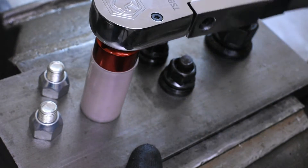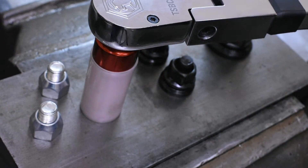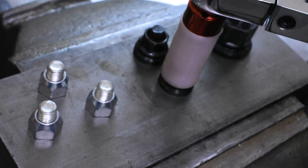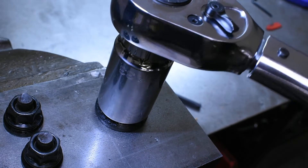We have three different sizes with three different torque specs. Half-inch is 100 foot-pounds, 14 millimeter from an F350 Super Duty is 150 foot-pounds, and this big rig lug nut is 500 foot-pounds, which required this three-quarter inch torque wrench.